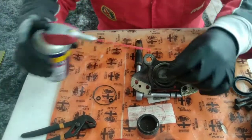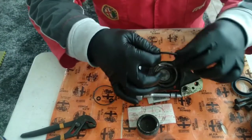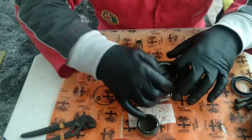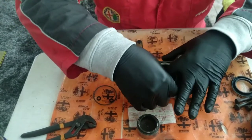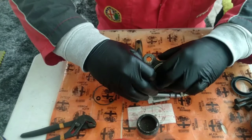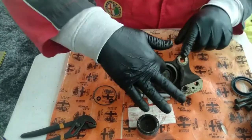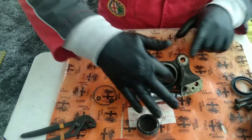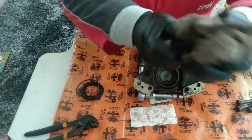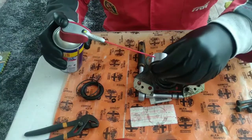Okay, let's soak the rubber sealant here. It's nice — put it in the square groove. Be careful not to be crooked. Sometimes it may appear difficult but it is not. I'm passing my finger to feel it — it's all good. Next step: be sure your parts are always very clean, then lubricate the piston.